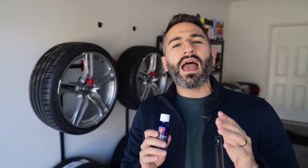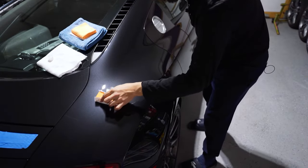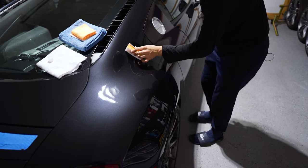In this video, I want to show you — while I have my 2008 Audi R8 wheels right behind me — how to go ahead and ceramic coat them to protect them for the coming season and to make sure you can wash them really simply and easily going forward. Just like your car that you would ceramic coat, the biggest benefit of a ceramic coating is to make it easier to wash and maintain.